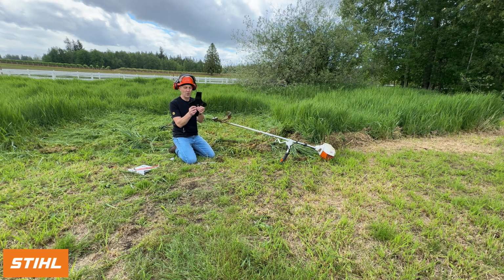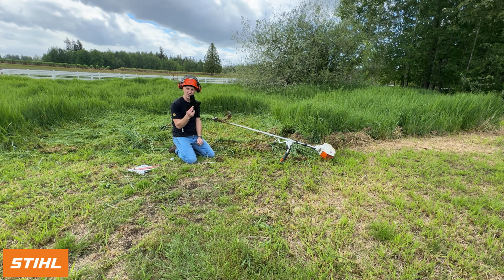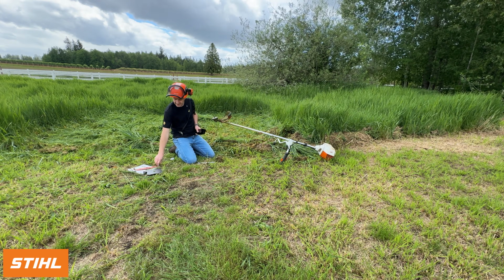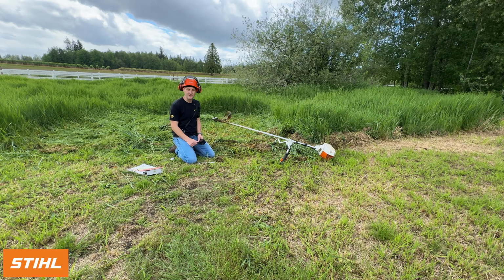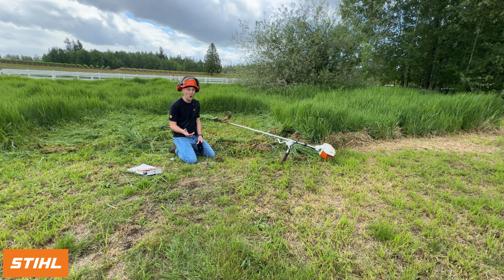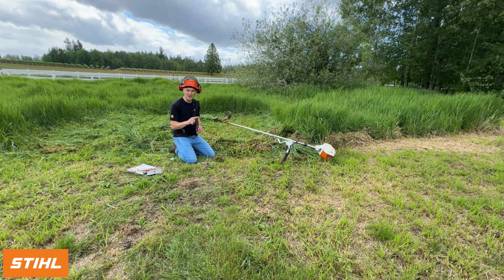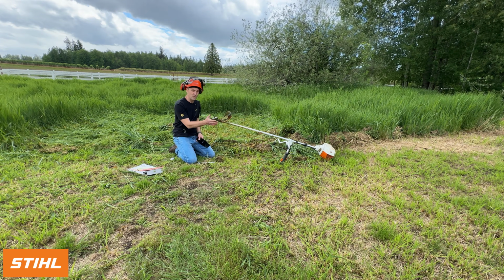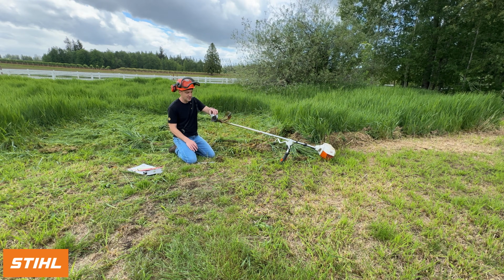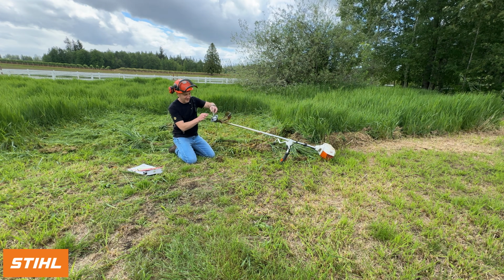Okay, here's my blade. So this 14-inch blade is roughly 2 inches longer on each side. So that's gonna cover a lot wider swath. Awesome, that's good. Disadvantages with this blade, as well as this blade right here: if you're going into some virgin territory where you don't know what's in there, rocks or T-posts or old cars, I mean, who knows what's out in the long grass or blackberries, right? But you hit something solid that doesn't give with this blade on the tip, and you risk damaging the gearbox. So keep that in mind. I've done it myself. Last year, actually, I was doing some cutting and all of a sudden, bang! And I looked down and I saw a T-post. That didn't feel very good.